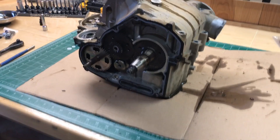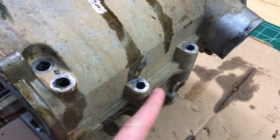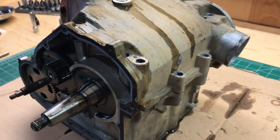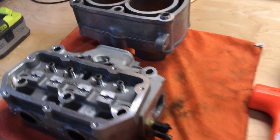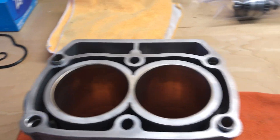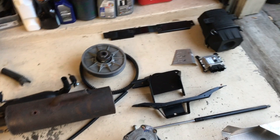It's been about a week now — we waited on some parts and got this flywheel puller. On your engine it goes flywheel, magneto, then you've got the casing and side egg casing for your cam gears and stuff — we got all that off just unbolting. We've been soda blasting some of the parts to get them really clean — don't want to go through all this work and slap dirty parts on it. We ordered another used engine and took the best components from both and rebuilt it. Now we're going to try to break this open.